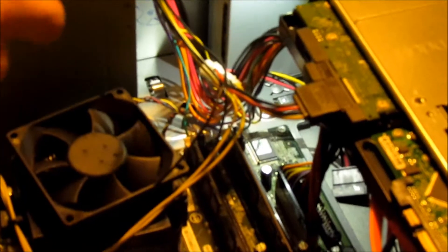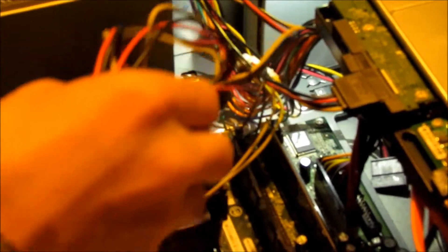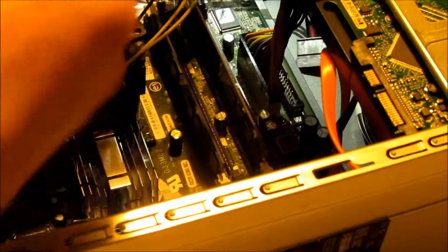This one doesn't have too many cables, but if you have extra cables, usually plugging them into the extra DVD drive slot is a good spot to store them. Or there's plenty of open space, but you don't want to put them anywhere that's going to obstruct airflow, because that will be bad for heating. So set that in there to get power for the graphics card.